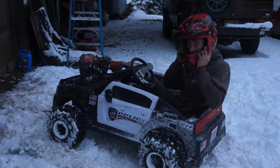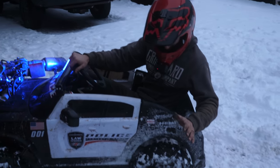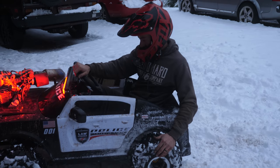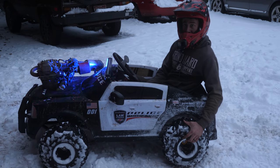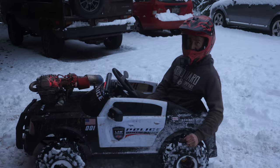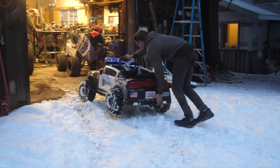The chain's flipping, so there's no chance of getting up to speed. These have way more traction, so it's putting the power down like it should, and the second you get too much grip, like up a hill or something, then it just slips. So maybe at this point I could even take out a link, tighten that up a bit. Yeah, other than that, really ready to shred.